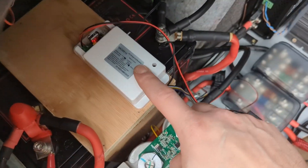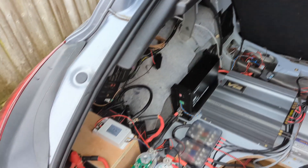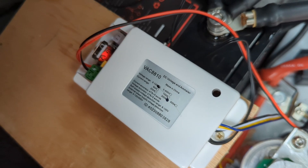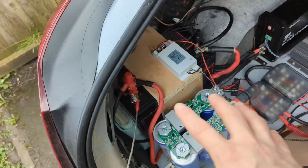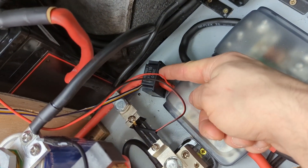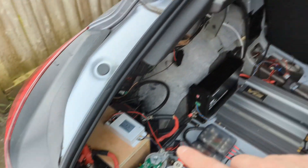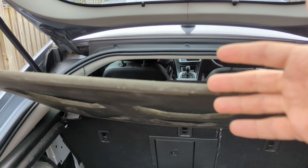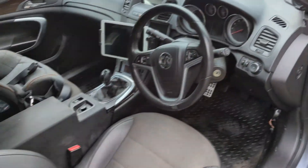If you have the shunt very close to the actual meter it's correct, but extending the wires makes it incorrect. So because of that I bought something else — a meter that sits up front with a screen, and I believe it works on radio frequencies. It's a transmitting box: you connect your main battery voltage, and a clamp goes on the main power wire going into the distribution, measuring amperage and voltage, then transmits to a receiver that can be powered by battery or USB.